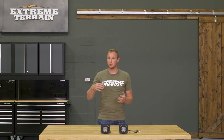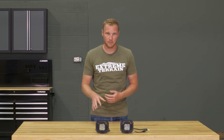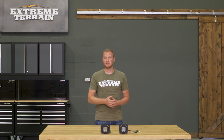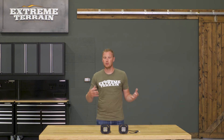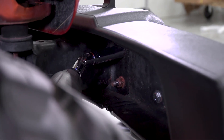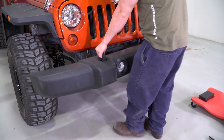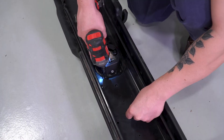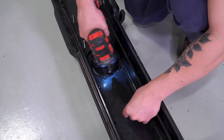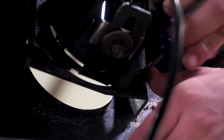Whether you're building or buying a harness, it is going to require some splicing, possibly some soldering, running the wires, and getting the switch in place. If you're not comfortable with all of that, it's okay to take your Jeep to a shop and have them wire these lights up. As far as the installation itself goes, the easiest way is to remove the factory front bumper — remove the fog light socket from the fog light housing, unbolt the four bolts holding your factory bumper in place on either side, remove the bumper, and get the splash guard out of the way. That'll make it easy to unbolt the four screws holding the factory fog light housing in place, and then bolt these brackets and your new lights in place.